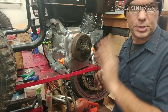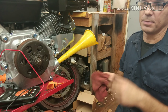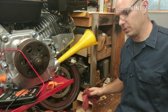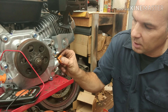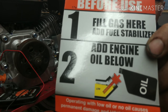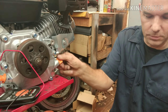I'll also line that up with the chain and everything, but we're getting along here. I'm going to top it off with oil and check spark. I've got to set up the kill switch for the switch that's on the steering column, so let me get it filled up with oil. Should be enough. Also, you don't thread the dipstick in — you just stick it in and take it out. So we're good on oil right there.